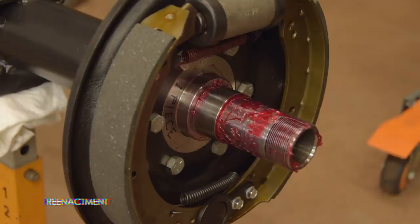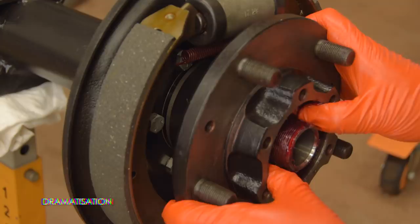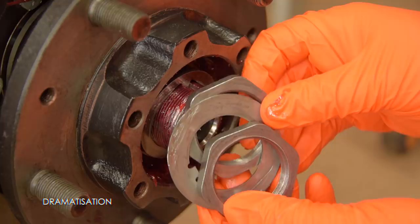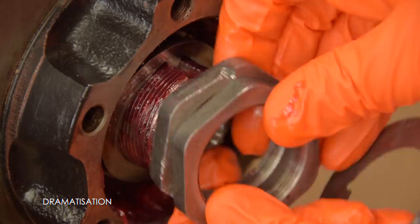Picking up the hub — and you do this while holding the outer bearing in place with your thumbs — the hub should just slide onto the stub axle, being careful not to damage the rubber seal. We have to hold the hub in place, and that's accomplished by this series of washers and nuts: there's a thick washer, more like a spacer, then a nut, followed by a locking washer, and then a locking nut. Your nuts probably look a little old and tired like mine, but that's okay — just make sure the faces are flat. I stoned these down to make sure they ring together smoothly.